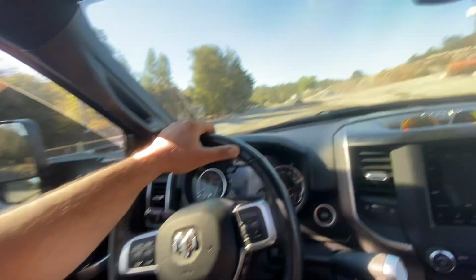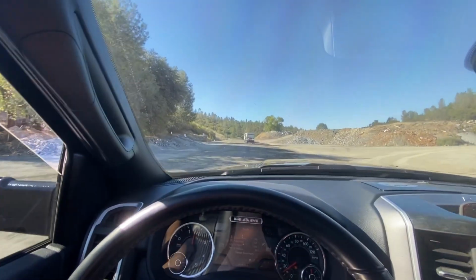My second gen would hate life if I had this much weight. Whenever I got gravel with the second gen, it was 4 tons. 4 tons of gravel. That's it. Especially with going up and down the canyon over here, it is terrible. It is just terrible how steep the road is. I've said this in my other videos, you're going down at 8 to 9% grade with like 10-mile-per-hour switchback turns going through this road. So exhaust brake is your best friend.